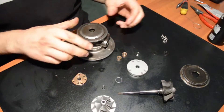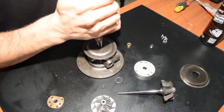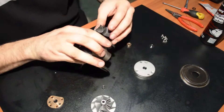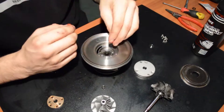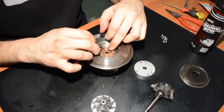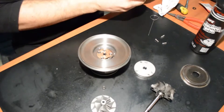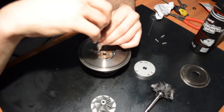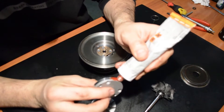Now is the turn of turbo number 2, and the same process was repeated. A very important note: when a turbo is disassembled and reassembled, it is extremely important to have it checked for balance, because there is a risk of being slightly out of balance, which in time will destroy the turbo. However, in my case, I searched many turbo shops in Malta and no one helped me out — either because they did not have the correct brackets to hold it for testing, or they did not trust my work, or some other excuse such as saying I didn't know what I was doing.